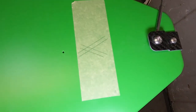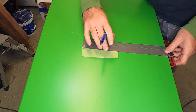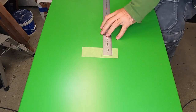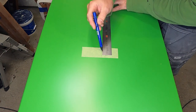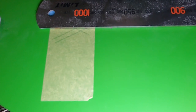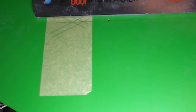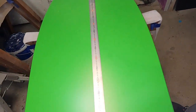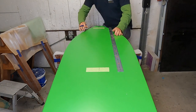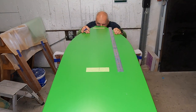By the way, this thing is made in USA. I mark two points within one meter. Once I have them marked, I use a straight edge or one meter ruler to draw a centerline connecting those points. This is a pretty simple exercise. I'm still eyeballing the line to make sure it passes through the center of the steering post. I also used to use a laser to project a line, but nowadays eyeballing with my experience is sufficient to find a centerline.